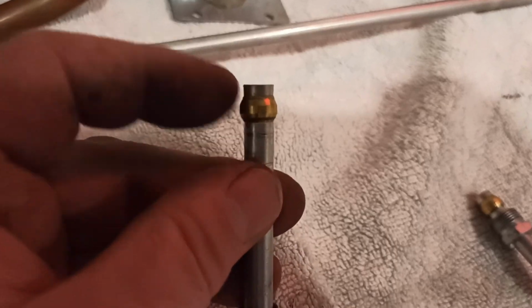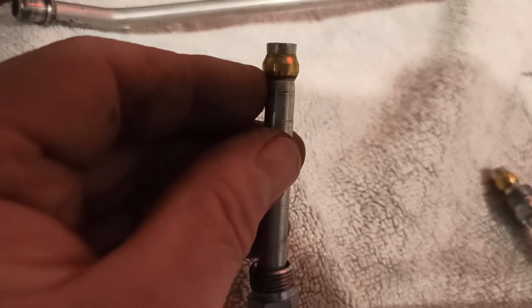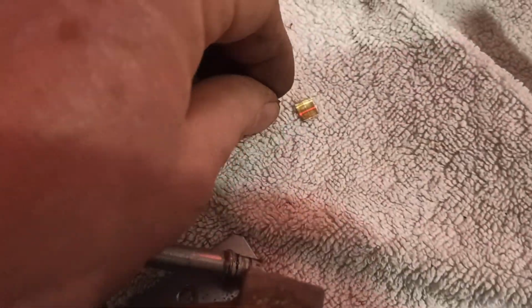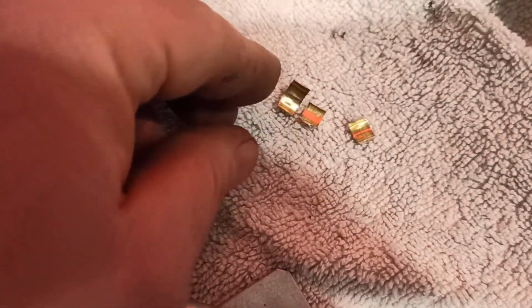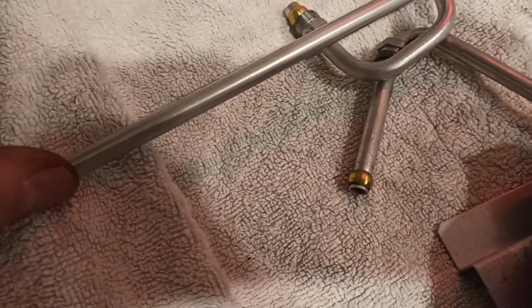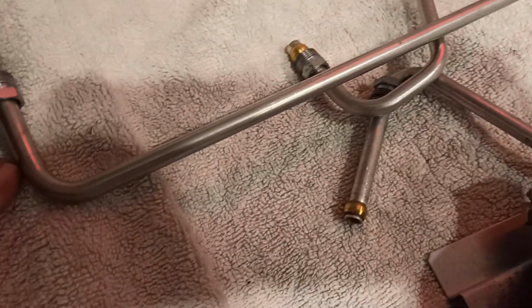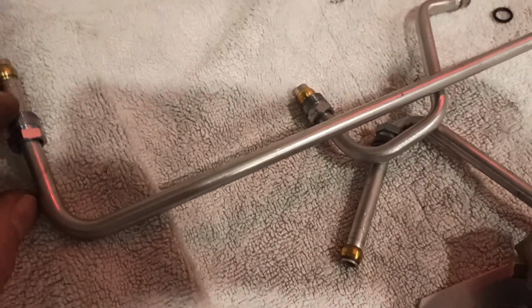And on the other end here, where it goes into the burner, there's a little brass ferrule. And I've found, if you really want to recover that, if you squeeze it that way, and then squeeze it on the 90-degree mark, squeeze it back again, it will fail and fracture, and you'll get 2 or 3 pieces of brass out of it. And then again, you can either put it in with your irony aluminium, or proceed to cut it even more to separate the aluminium from the iron.